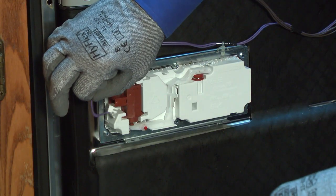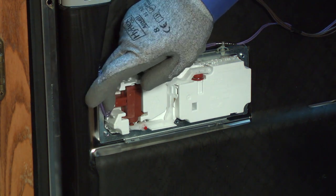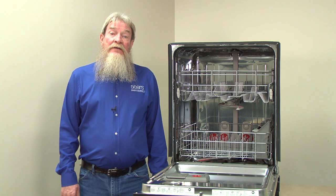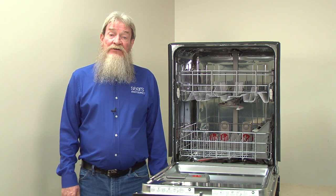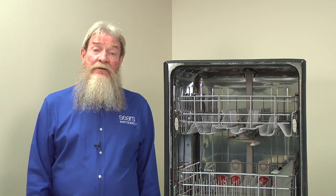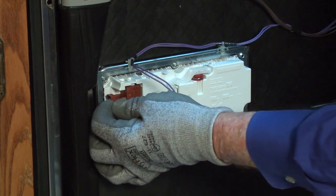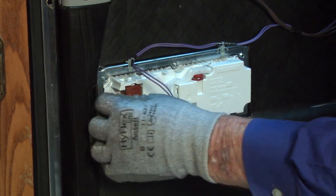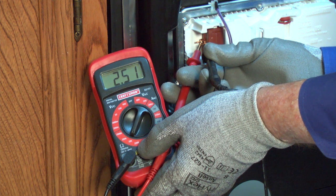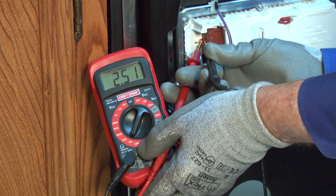Check the wire harness connection on the dispenser and reconnect the wire harness if it's loose, or repair it if you find damage. If the wire harness looks okay, check the resistance through the dispenser actuator using a multimeter — checking resistance of the actuator tells us whether current can flow through it. Pull off the female wire harness plug to expose the actuator prongs. With your multimeter set to measure resistance in the 20,000 ohm range, touch one meter probe to each dispenser prong.